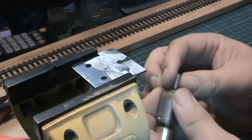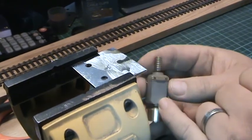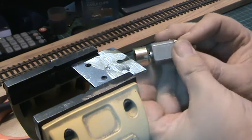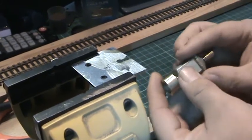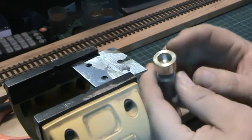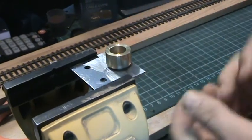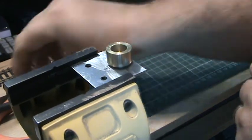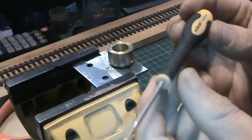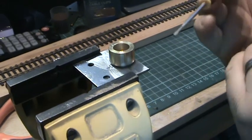There is a procedure, and if you don't get it right you'll end up knocking the internal washer that actually holds the motor in the correct place off. So what we need to do first — place it in there like so. I'm using a Rolson T6 as it is exactly the right size and much better than a nail to knock the shaft out.